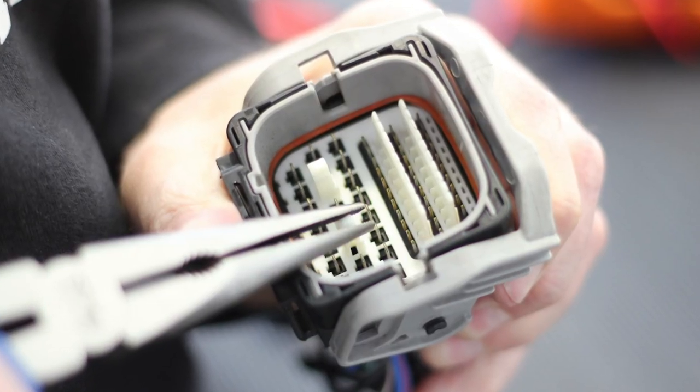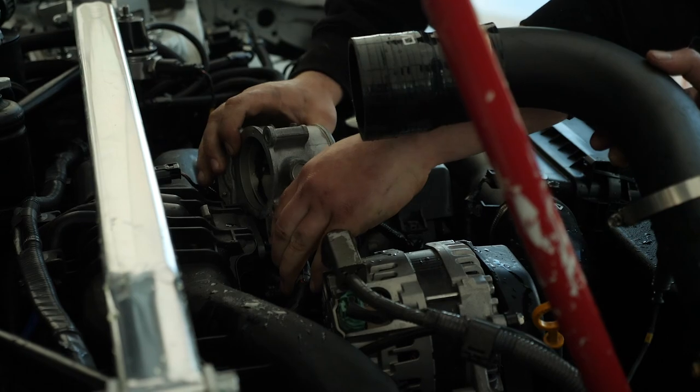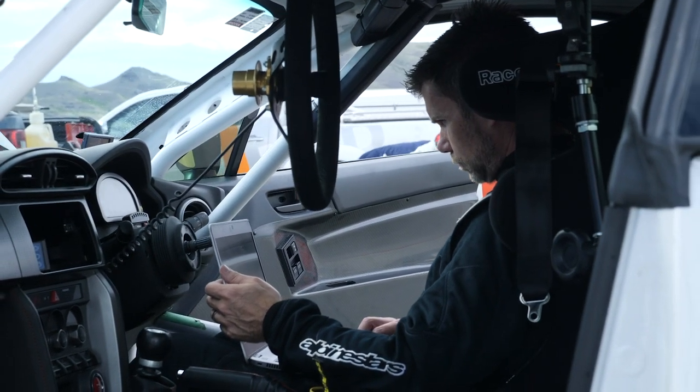That approach is great for an actuator like an ignition coil but not practical for our wiring harness, because we obviously need to be able to undo that harness. In the case of our variable cam control fault, the solution was to simply extract the terminal for our cam position sensor and, using a pair of pliers, just crush down that terminal very slightly to provide a little bit more tension on the pin it mates with. I was just doing this to test, but four years later it's proven to be absolutely perfect. Getting back to our drive-by-wire fault — again with the car powered up but not running, we could wiggle the wiring either side of that factory bulkhead connector and in MoTeC software we could see the throttle position as well as the manifold pressure and oil temperature all fluctuate erratically, confirming exactly the same problem.